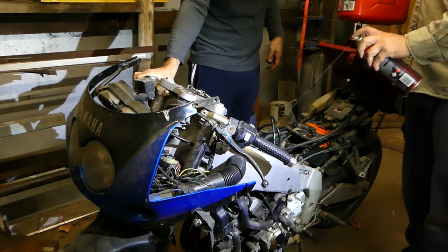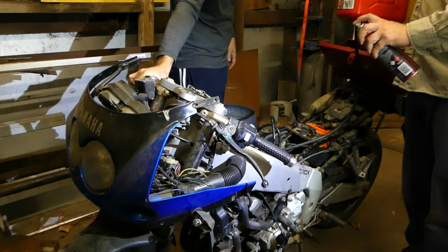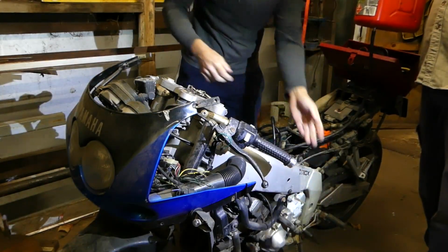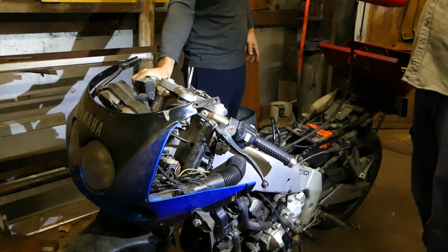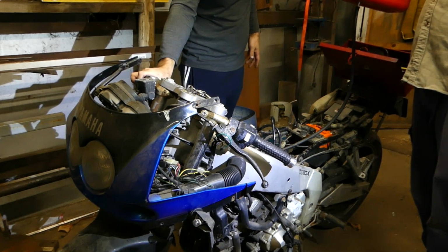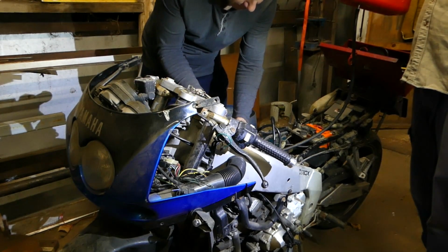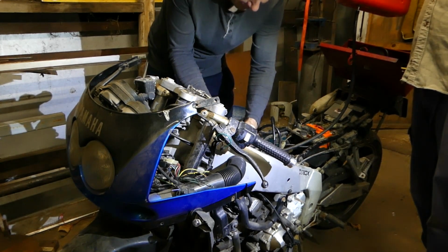yeah. It's firing. It's firing. Where's the choke? On the nut. Full choke. Sounds healthy though. Have you checked the spark plugs? No. Oh, this is not even connected. The CDI. Alright, let's connect that.